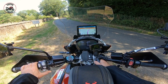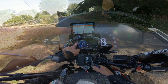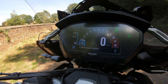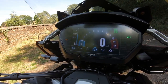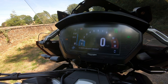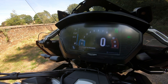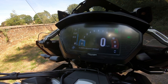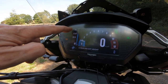That should do it. So now to select it — I'm currently in road mode here at the top. Using the menu button on the left hand handlebar, press that to bring up the icons, then scroll across to the rider mode with the helmet and select that. You'll notice the adjustment is in progress — it's actually lowering the bike at the moment. Instead of being on tippy toes, I'm not flat-footed but it's a lot better, and it's now selected that as my rider mode.